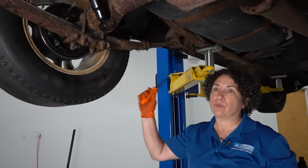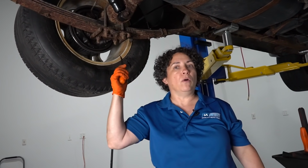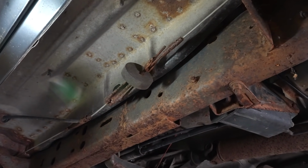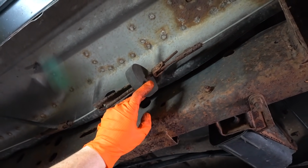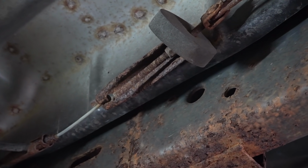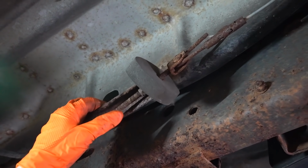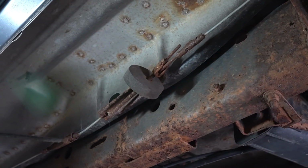So, proper way to do it is really to start at the e-brake cables. There are no e-brake shoes other than the actual shoes themselves. They're used as e-brake, parking brake, or the braking shoes. So the adjuster is way down there. This is the parking brake cable adjuster. It is adjusted literally at the end of its adjustment. So proper way to do the shoe adjustment is to back this off so that the cable has slack in it, no tension at all. That is the proper way, right out of automotive repair school.